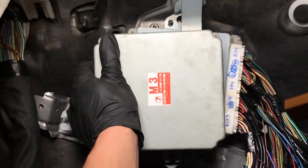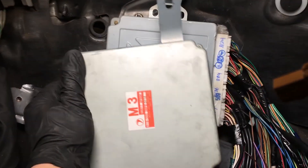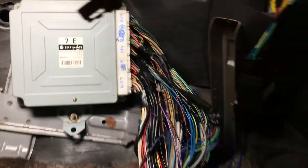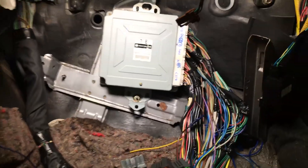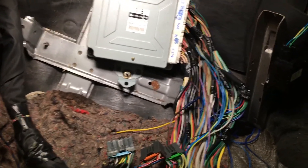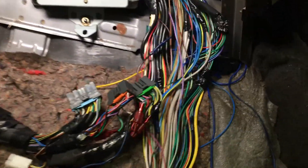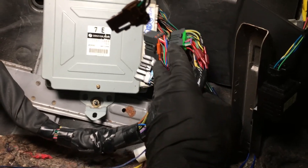This is where the old ECU mounted up and I have the new one secured in. It's pretty close - I don't know if it's going to block the shield when I put that back on, but we'll see. Right now these are the GC8 wires and these are the ones for the WRX, and essentially I'm going to follow this chart, figure out what wires go with what, cut them, and then splice and solder them together.